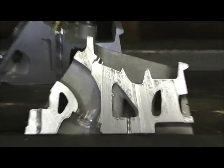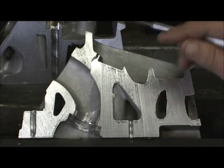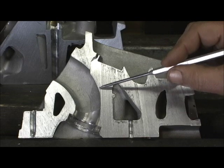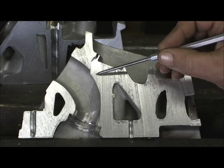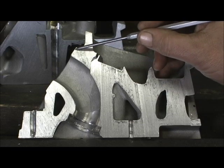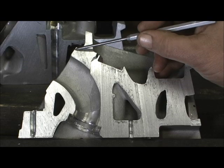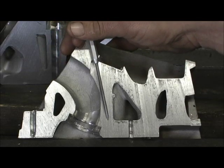the floor. Let's get a little closer. I'll come up and start taking that turn out. You see the apex here. I'm going to come and I'll start cutting like this and try to bring that up as high as I can where I've got just enough flange for the header. And basically, I'm straightening that out.